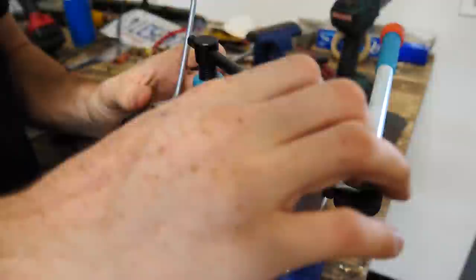So if you're looking for brake line fittings, instead of buying these incredibly overpriced single fittings, look at some of the pre-made brake lines that your auto parts store has and just harvest the fittings off of those. Little Gingium tech tip. Now that I have these fittings, it's time to get back to work.